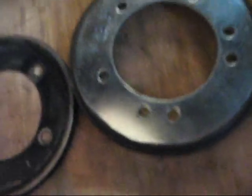We finally have it off. Once we got all these bolts off, two pieces came off: the front guard right here and the drive disc. This one still has a bit of rubber on it, but notice all these cracks here. It's been sitting all winter and it's been used a lot. We have a lot of rough terrain in our area too, so this makes the drive really crappy. Better off to just replace it, but I'll save this as a backup disc since it still works perfectly fine.